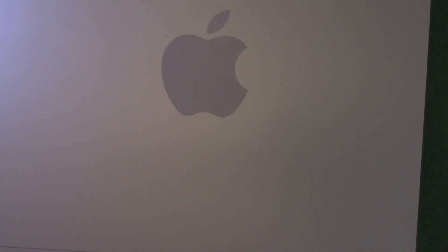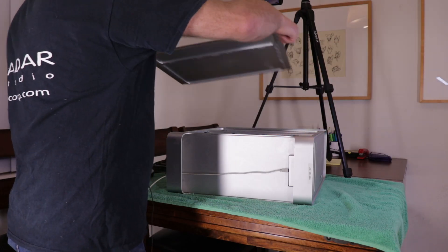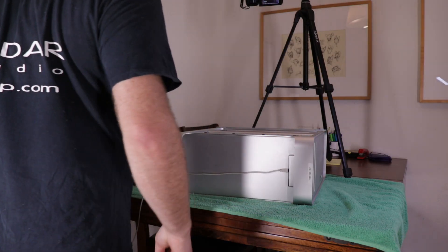This isn't a big scary operation and I'm not too worried about it. The first thing we have to do is remove the cover. The beautiful thing about these old Mac Pros is that it's incredibly easy to do — there's one lever on the back, you flip it, and the cover comes out, exposing everything you need.